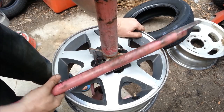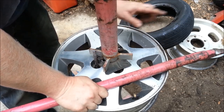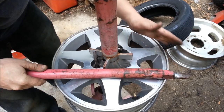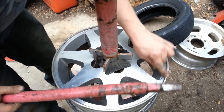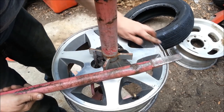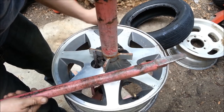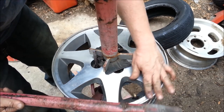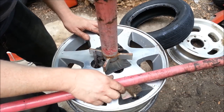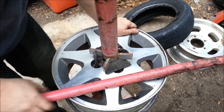When don't you want to use a manual tire changer? When you're completely in love with your rim. A manual tire changer rides on the edge of the rim at least a third of the way around and scuffs up that entire section. It's a smooth scuff, not as bad as a curb bash, and it can actually smooth out existing curb damage. But it will scuff the outer ring. A lot of older automatic machines like Coates machines do the same — you pretty much have to buy a brand new machine to avoid that.